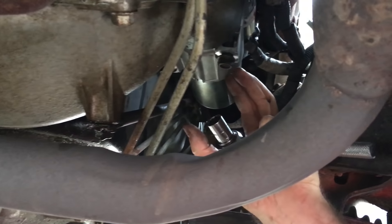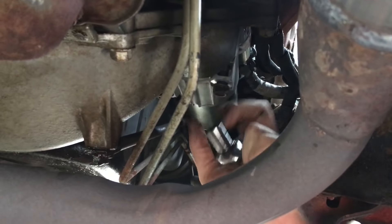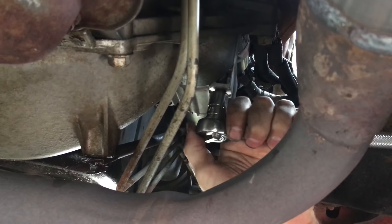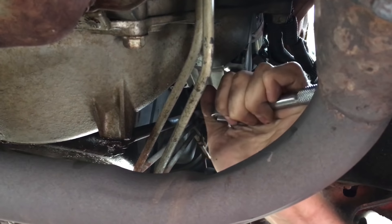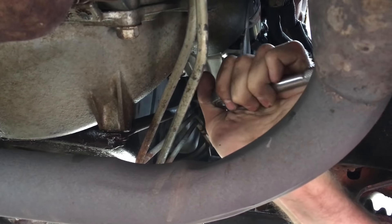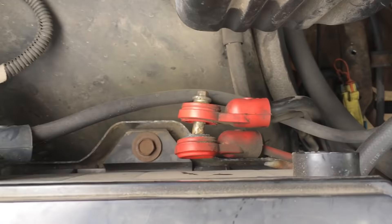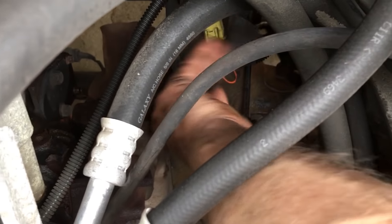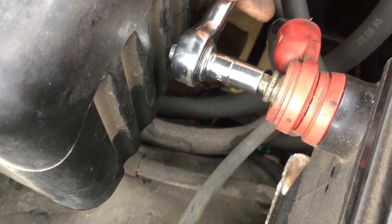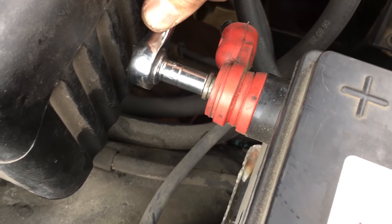It was too tight to shoot video here, but the starter just slides in real easy, then you put the two bolts in and you're good. When you torque them down, make sure all the electrical connectors are connected tight and the connections are clean. Make sure you didn't knock anything else loose while you're down here. Then tighten that strap down, tighten that strap down, make sure there's still enough clearance, and hook up the battery. Be gentle when hooking up the battery — don't over-torque it or you'll rip the threads out if you have one of these side-post batteries.